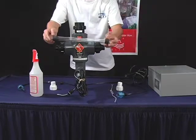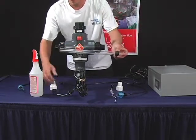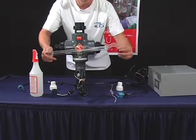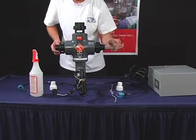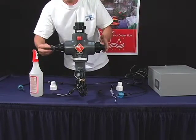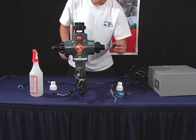Now take your new quartz sleeve and remove the black O-ring and the rubber seals. Slide your new quartz sleeve into the unit, keeping it straight and making sure that it is centered. The black rubber seal should be halfway in and halfway out of the Easy Twist cap.